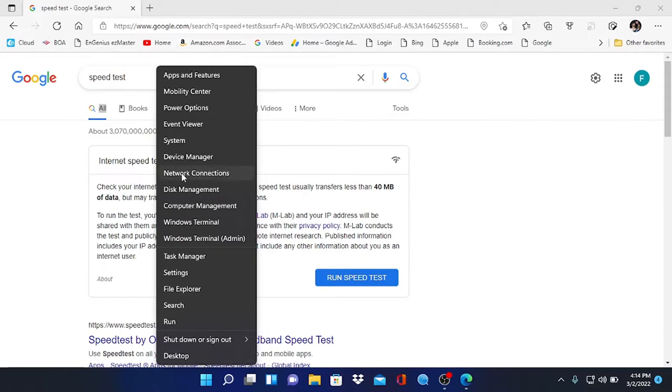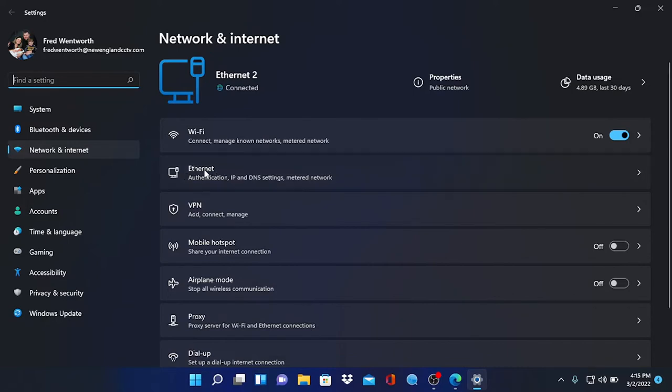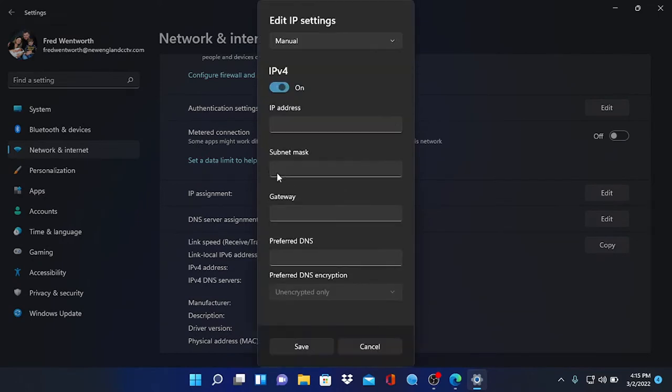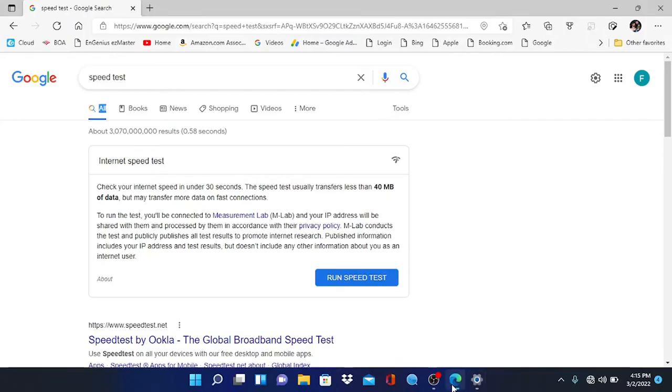This computer has been upgraded to Windows 11, so here's how you switch your Ethernet adapter's gateway. Go into Ethernet, and under IP assignment you'll see it's set to DHCP — automatic configuration. Click Edit and switch that to Manual. Turn on IPv4, and for the IP address type 192.168.188.200 with a subnet of 255.255.255.0. This puts the computer on the same gateway as the access points so we can log into them. Hit Save. The host is at 192.168.188.253.